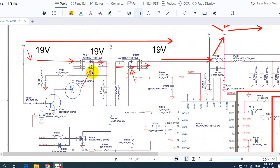The first important tip: when you have a no-power laptop, always focus on the first circuit with the charge IC and check those two switches. In my experience, usually one of the MOSFETs has failed. If you find a failed switch, you have two methods. The quick method is to make a shunt between the drain and source points using a thin wire, and the laptop will work.